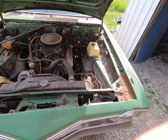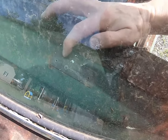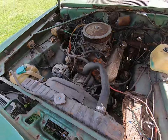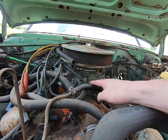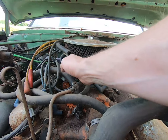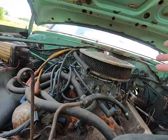Under the hood, we still have an engine in here — and it's not a slant six, it is a 318 V8. That is original to this car. The fifth digit on the VIN is a 'G' — that means it's a 318. You can also look at the engine itself to confirm it's original. It's a 318, the LA family. This one has had some stuff done to it — it has a four-barrel carburetor, which was not stock, and it has an old-style Carter AFB Competition Series carb — kind of what the Edelbrock Performer is now. I'm guessing it's probably a 600 or 650 CFM. It's got some Moroso wire looms and Moroso wires in some places, but then some other ones — kind of a mishmash.